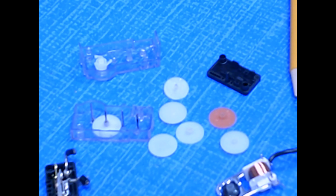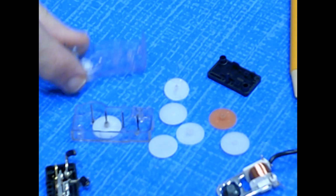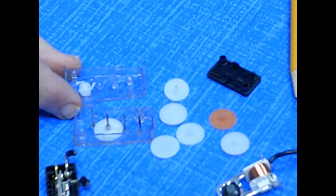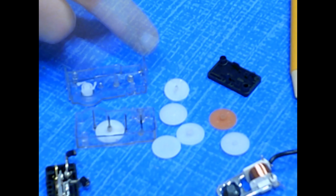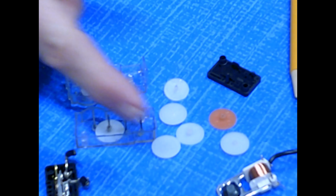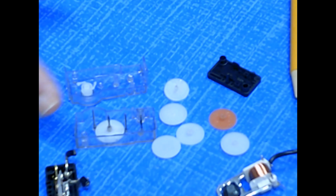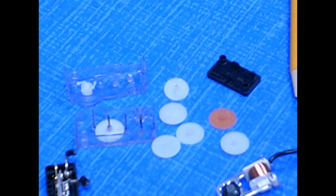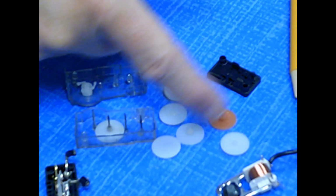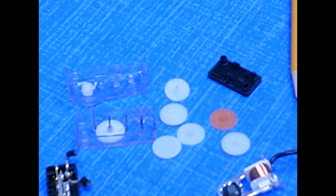One of the enjoyable parts of taking something apart is seeing how the subcomponents, in this case the switch and the motor, are put back together. Could I have repaired it? I doubt it. It's also interesting to see how it was assembled so that I didn't glue it. I could take it apart, put the pieces in it. This is not using 60 cycles, which is American, but uses 50 cycles, which I believe is European. You would need a slightly different set of gears. You would just switch out one of the gears. Instead of a 60 to 1, it would be 50 to 1 turn over here.